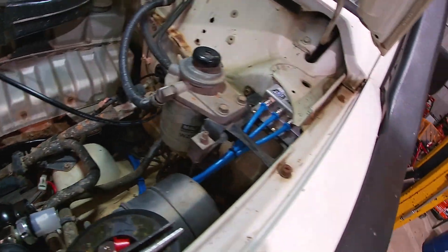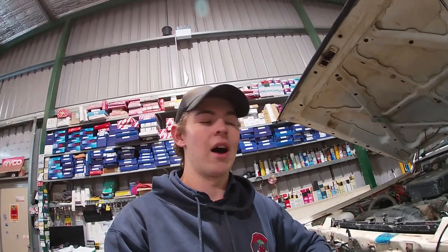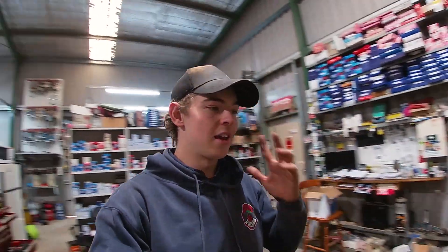That's all you need to do for your diff breathers. We've run our diff lines all the way up to the engine bay - up to about my chest, so roughly one and a half meters high, which is great. I'm not going to get any water in my diffs, gearbox, or transfer case, which I'm stoked about especially since I've just put new diffs and new lockers in. That extra peace of mind is awesome. Thanks for watching - catch you in the next episode of Outback Trekking. Any questions, drop them in the comments and I'll get back to you.